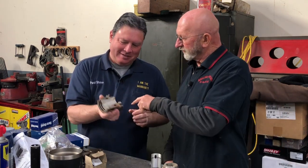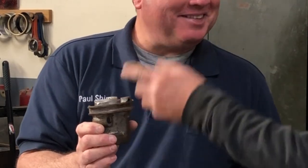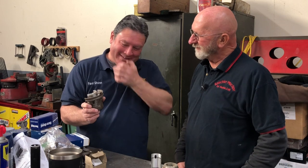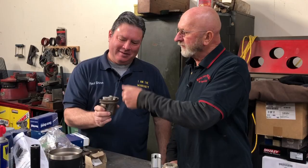The other issue is the oil return tube. If the tube is down into the hole too far, it plugs up the return hole — that's where a lot of guys get rear main oil leaks. You talk about having your engine Babbitted and then oil just gushes out the back. It's probably because this drain is plugged or the tube is too far in. You've got to be careful when pouring Babbitt not to plug that hole. You always want to take this core plug out, make sure you drill a hole through there, and verify that pipe isn't too far in.